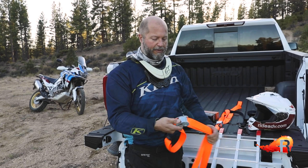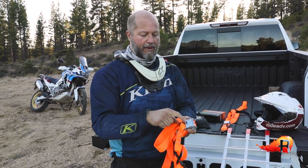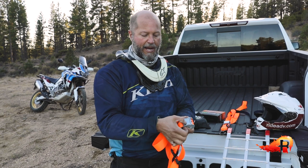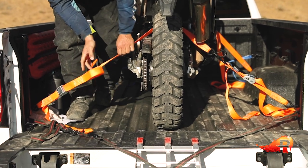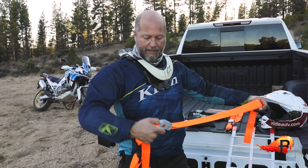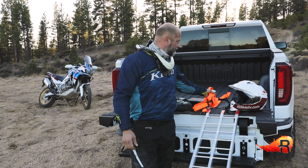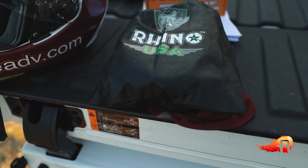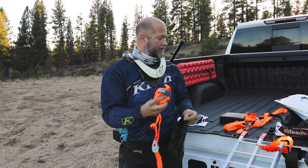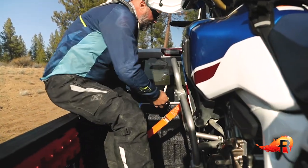Another feature I really like — aside from the beautiful orange — is that this cam closure locking mechanism is a good long one. There are others out there that are about half that leverage distance. With this one, you've got some leverage to push down to release the strap, because when you get these things tied down tight, it can be hard to break loose with a cold hand. The Rhino straps come in their own pouch with a little Velcro to keep them looped together — a great option for securing your motorcycle with the right tie-downs and the right aluminum ramp.